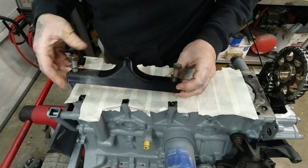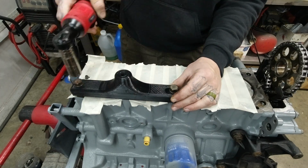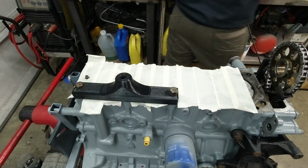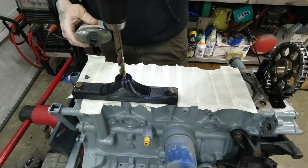And now I 3D printed a drill guide to ensure that my drill will stay vertical and true, direct with that hole. It's referenced off of the adjacent bolt holes. Goes in place, test it with a bolt, threads right in, that thing is dead centered.